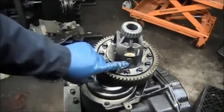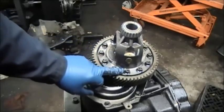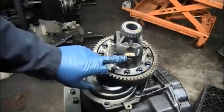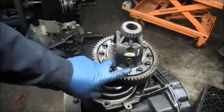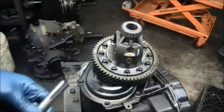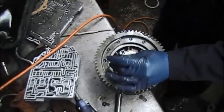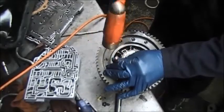Okay, so you have to knock this one out. It has a pin, but to use it you have to use the 2 retainers. I'll show you what that means on the retainers. But you have to knock the pin out. Use the retainer because it doesn't have a spot for a roll pin. So we're going to knock this out, the old one that is, which has a place for a roll pin.